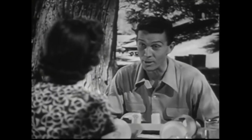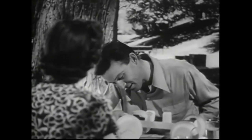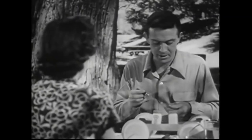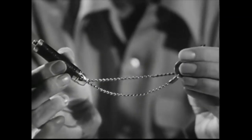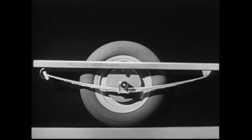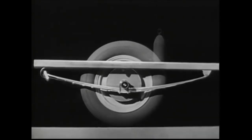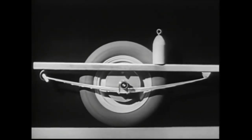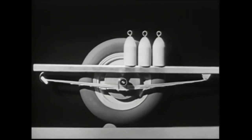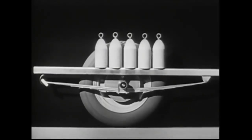Center point seating is just one of the reasons why our new car rides so comfortably. Another reason is what they did with the rear springs. Just imagine this chain is a rear spring, and the flashlight is a gadget called a shackle — a kind of pivot. The spring is fastened to the frame at the front, shackle at the rear. When a bump pushes the wheel up, the shackle and spring act to cushion the shock. With ordinary springs and shackles, one passenger in the car gets quite a jolt from each bump — these springs are too stiff. However, three passengers get a pretty good ride. Five passengers can hit bottom. The spring is too stiff for light loads, too soft for heavy loads.